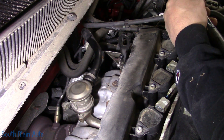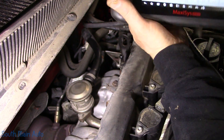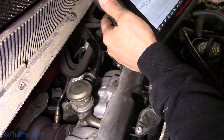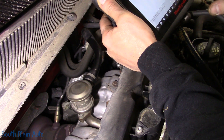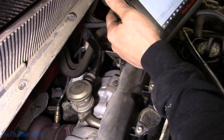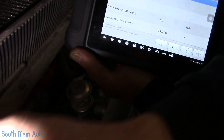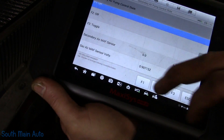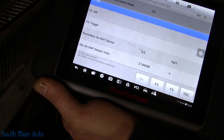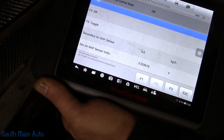Look at that — how she's flowing! 3.77 volts. We'll turn it back off. Let me kick it back on — can you guys see? Yep, it's actually open and working now, 3.8 volts. But like I say, we've got to start the car up, because if that thing is stuck open it's going to burn up every bit of hose and air pump and everything.